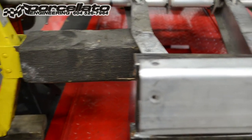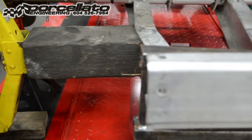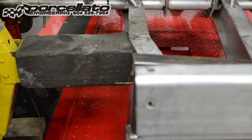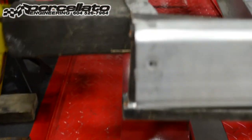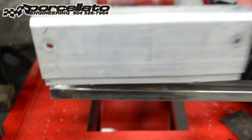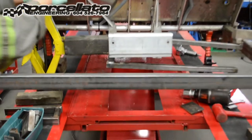In some cases the frame has swung so far over we don't have room to grab it with this particular tool, so we just put a scissor jack in there and push this frame member over just to get us closer. We're just trying to get that big ripple out of the frame, and then we can once again pull that whole section back over.